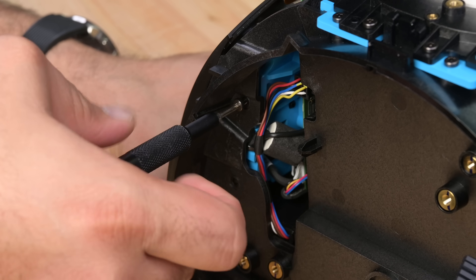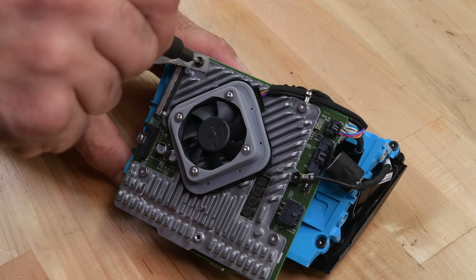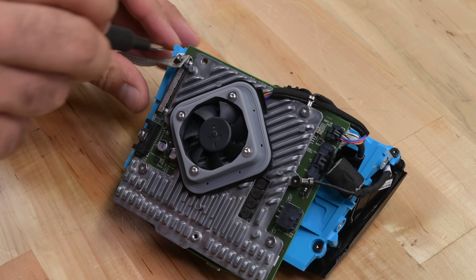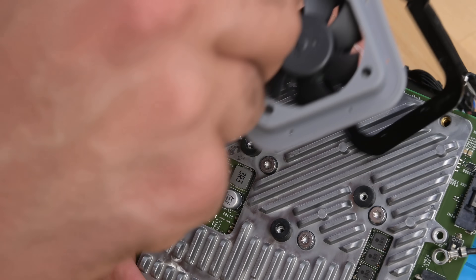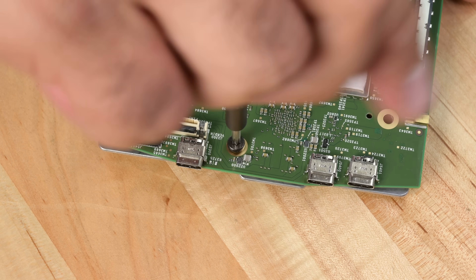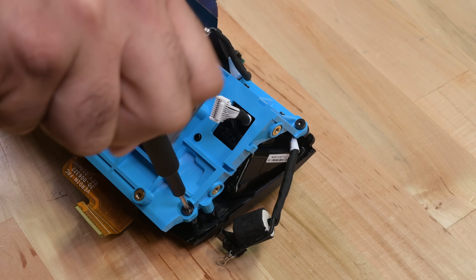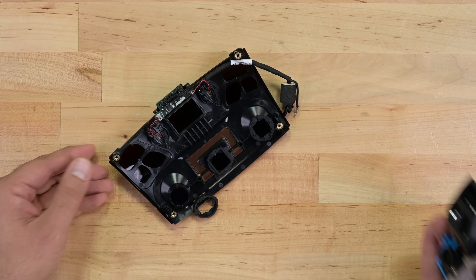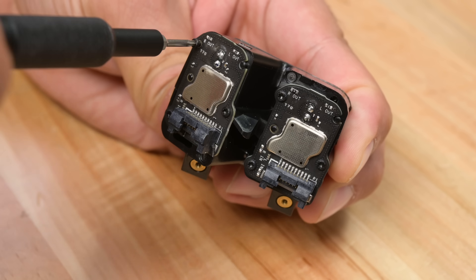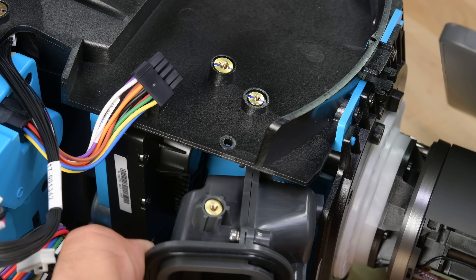Now I'm curious to see what's on the front sensor panel. Like everything else in here, it's a pretty modular piece that slides out, albeit with a good bit of poking and prodding. This cable is labeled as a grounding cable, but holy moly, that seems overkill. Well, it turns out that this wide-braided cable is a radio frequency ground. The front sensor assembly is layered between heatsinks and a single fan. Fairly easy work taking all this apart, but these sensors and cameras must run hot. The cosmetics of the device are particularly beautiful. Right from the start, this module looked like Astro's heart, but opening it up reveals the gorgeous colors in both the housing panel and the central lens. I'm going to remove and open up one of these headlight-looking things. Unscrewing the four Torx screws on the PCB reveals two sensors — at a guess, the top sensor may be IR. Let us know in the comments if you know what type of sensors we're looking at here. Let's remove that USB-C tray to get it out of the way.